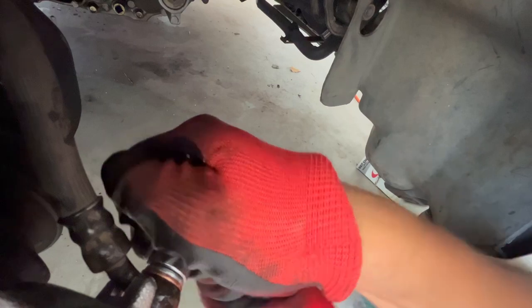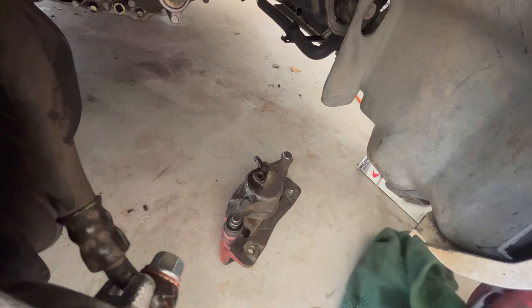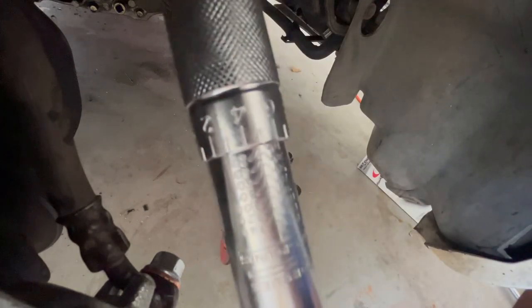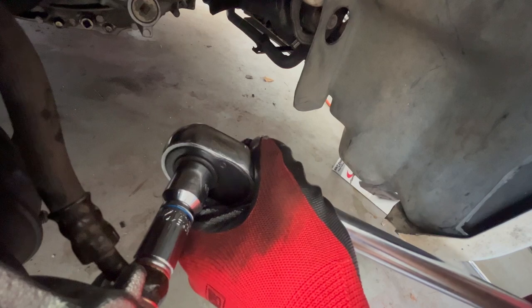Now I'm going to teach you guys how to actually get this thing to be functional by bleeding the system. But first I need to torque this to spec — the manual says that it's 15 foot pounds. So we're going to get our torque wrench right here, put the adapter on here, and take it down to 15. Right now it's at 80 because I already did the other side. But I just want to make sure we get it down to 15. There we go — it's already at 15, so that's good.